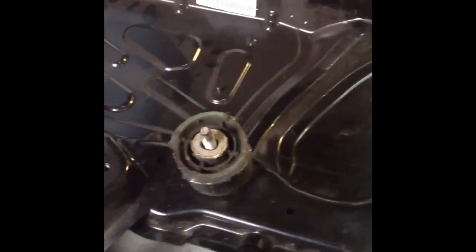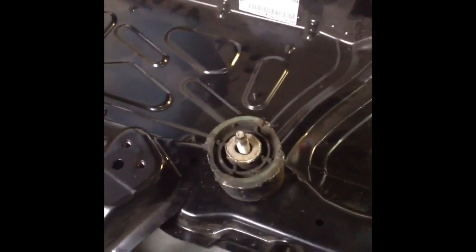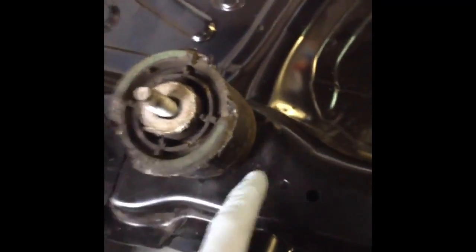The only other change we've noticed on this floor — and interestingly we picked this up and documented it in one of our videos a while back — is the design of the bush, which has these semi-circle lips contacting the floor ever so slightly, not a huge amount of energy, but where they contact the floor on the right front one they went straight onto a spot weld.